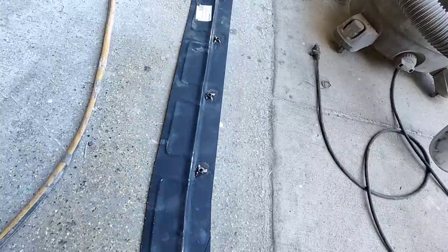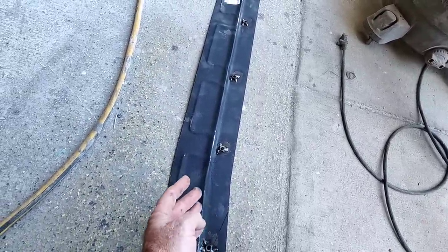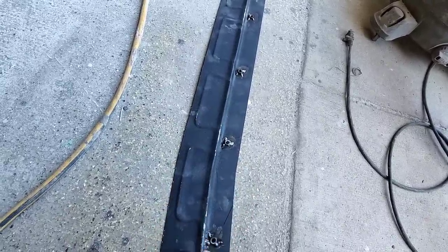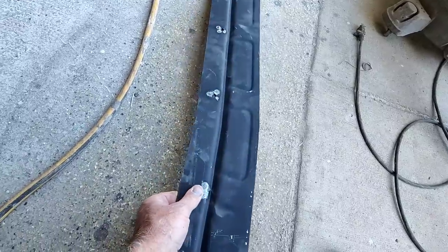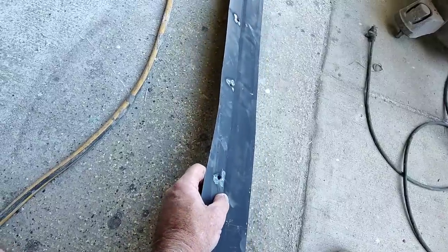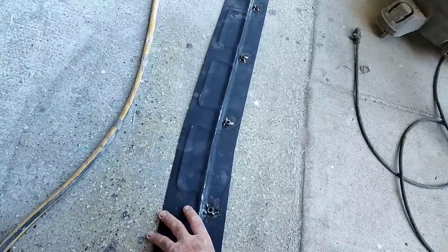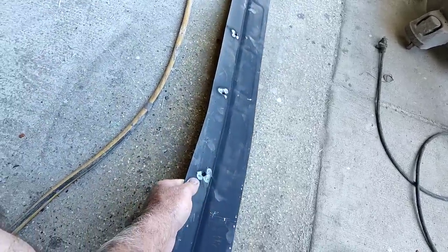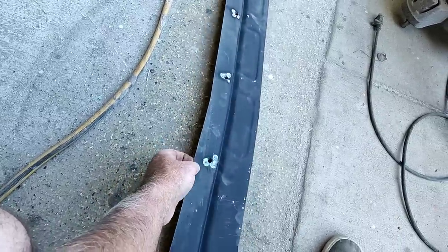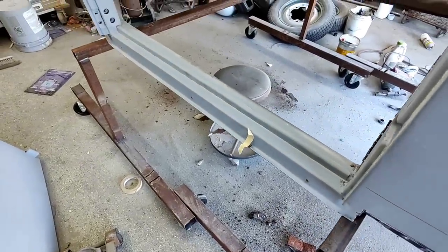So anyway, I'm going to double weld, paint all this, get that crap primer they have on there. That's just basically packing primer. Sand all that off and paint this side. Sand this off maybe and prime this side with epoxy primer, just so it's not going to rust. And then, well, I don't know, maybe I won't prime this till after it's in, because I want it bare metal. I might use the pinch welder to put this on. Just pinch it.